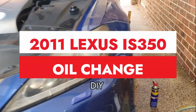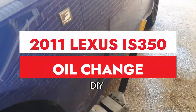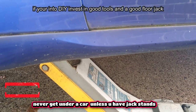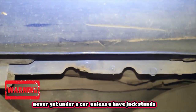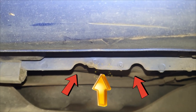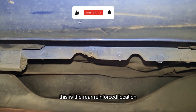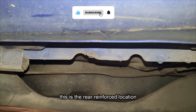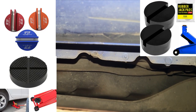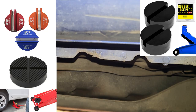As always, when you jack up any car, get a good jack and make sure you jack it from the right points underneath the car. There's always a reinforced part where you can jack it up from. You can see these two notches — you're meant to jack it in between those two notches. There are four spots for front and rear, and you can also buy jack pads to fit in that groove.